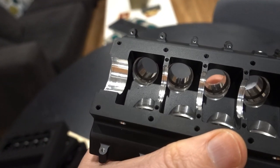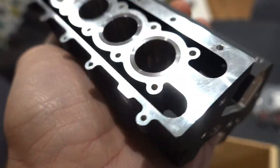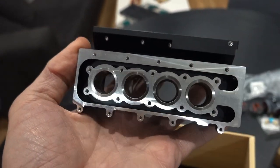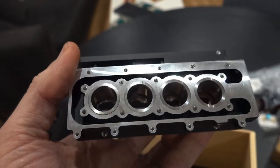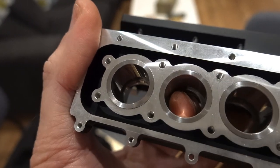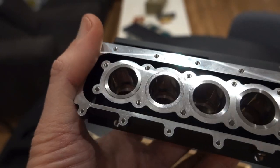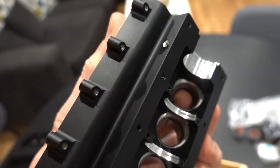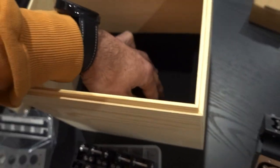Flip it upside down — wow. I think I can see the piston rings are already in the cylinders. If so, you need to make sure they're matched to the right cylinder because on some engines they machine and set the piston ring gap individually so everything is perfect. I think the ring is installed — when installing them you take the ring out and put it where it's supposed to go. Don't get them mixed up. That is one solid block of machined aluminium.